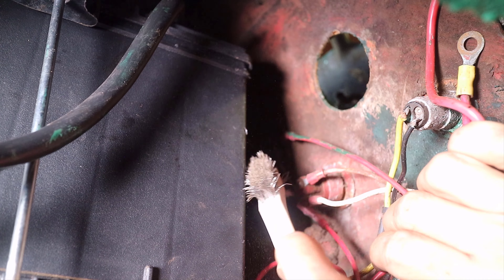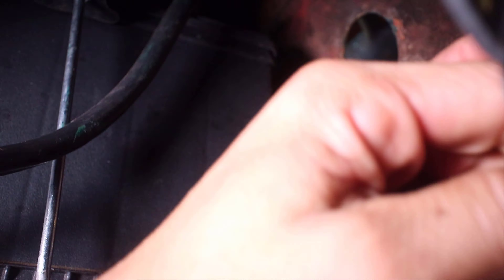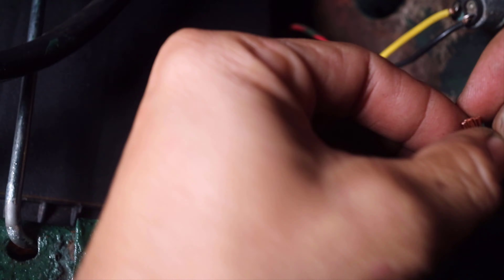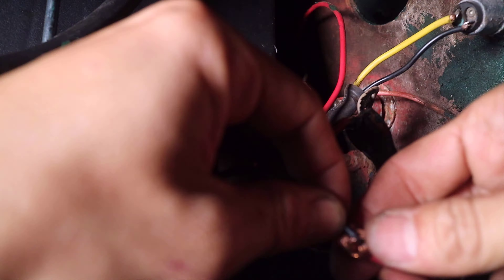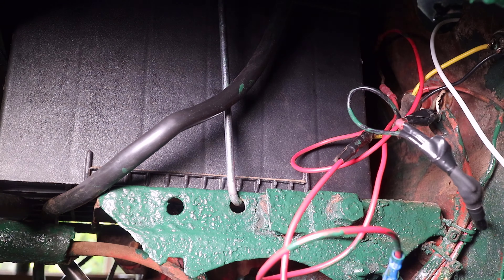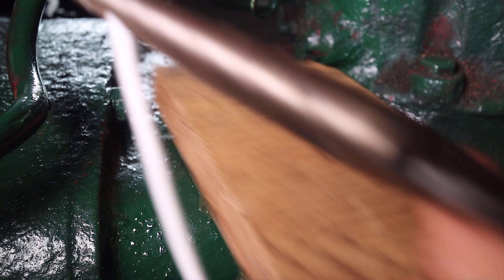Some of the connections to the wires were then brushed clean. Next, the wires were cut, prepped, and rejoined together. This is definitely not the best way to rejoin these wires, but at this point in the project the goal is to get this gauge in and ready for a test run. The more I looked and worked on these wires, the more it became likely that I would need to follow the suggestion to start over and rewire everything. The decision to rewire this tractor in the future would also be reinforced by reviewing the diagram shown at the beginning of this video.